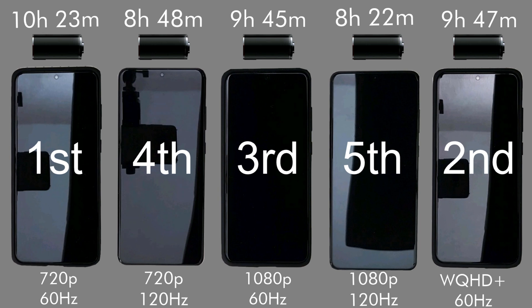So if we just compare the two 720p tests we can see that there's actually an 18% difference between 120 and 60Hz. Similar result for the 1080p 60 versus 120 — we have a 17% difference in battery life. So bear that in mind if you're going to switch to 120Hz, you're going to lose around 17 or 18% of your battery life. And the difference between the longest and shortest times, which is the 720p 60Hz and the 1080p 120Hz, is 24%. It's obviously just a test so you can see the time difference between the different refresh rates and resolutions. No one's going to use their phone in this way particularly, but it does give you a sort of percentage difference you can work out between different resolutions and refresh rates, so you can best set your phone for the best battery for what you need.